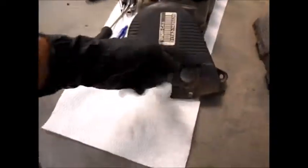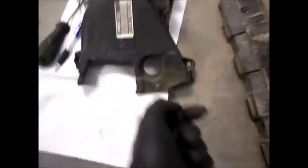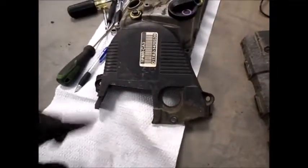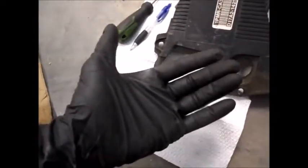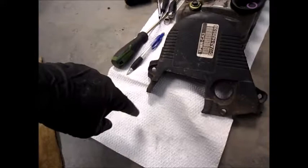I can't see it right now, but with this all still attached to the car, pull the rubber boot off. You can barely get your hand in there, get the clip and pull it, undo the connector. The sensor stays behind. Then stuff a rag down underneath the sensor, because when you take it out, you don't want the bolt that holds it, or the sensor, to fall down into the lower timing belt cover, or you have to start taking the whole car apart to get those pieces out.